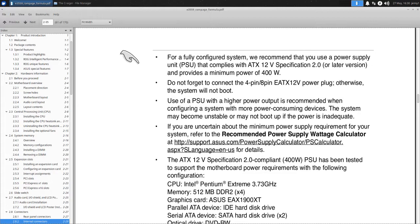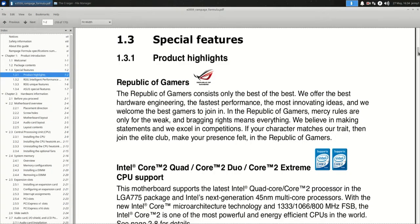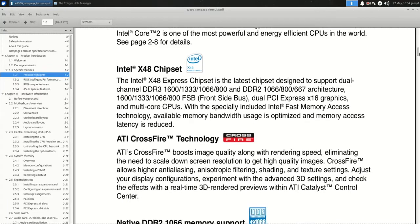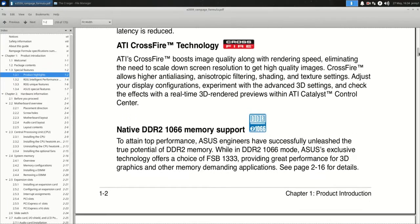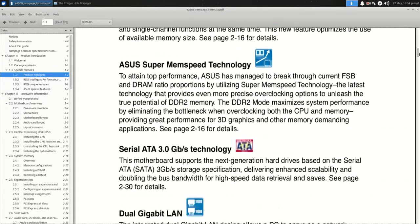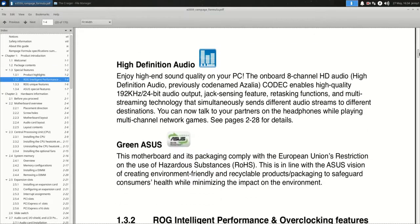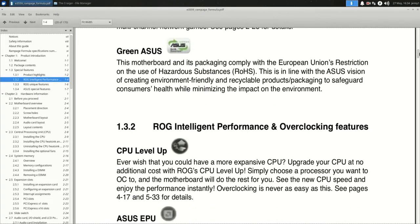Checking the motherboard manual. You do download the manuals, right? Always check out the fine manual. I discovered I needed a heftier power supply than the one I had. Along with needing a beefier power supply, a quick look at the features, and this seems like one serious motherboard from back in the day in 2008. The motherboard needed an 8-pin connector, and the power supply I had only had a 4-pin.